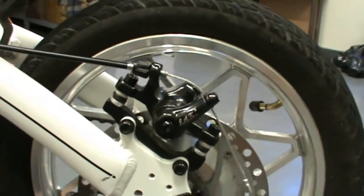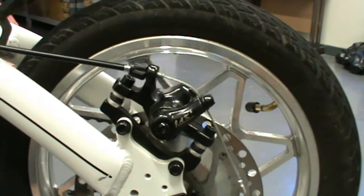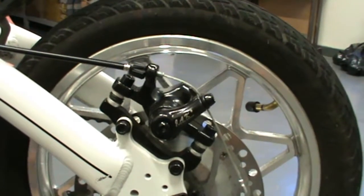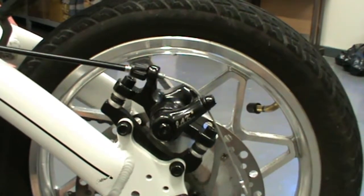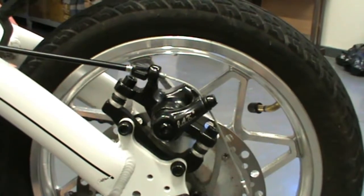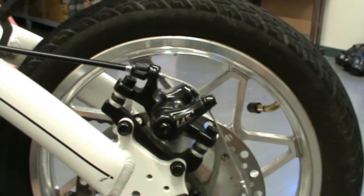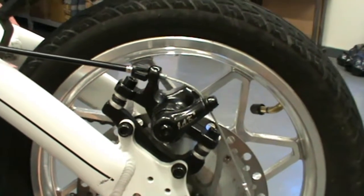There's no problem if your brakes are dragging a little bit, as long as they're not slowing the bike down. A lot of people get really over-pedantic about it — 'oh, my disc is making a noise.' Well, it can make a little bit of noise. It's only an issue if it's going to start slowing the wheel down. Sometimes you can have a little bit of noise and it's perfectly harmless. When your brake pads wear out a little bit, that will go away.